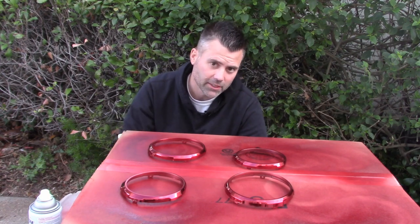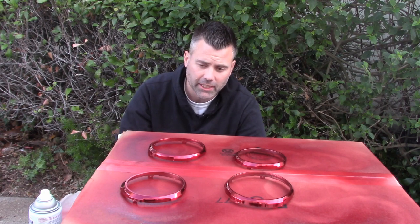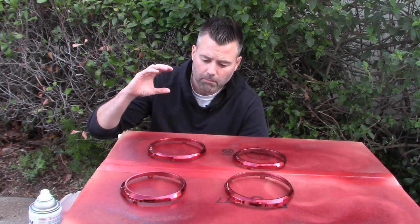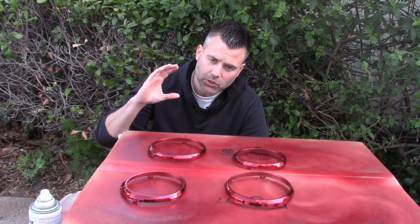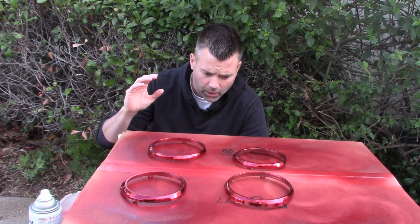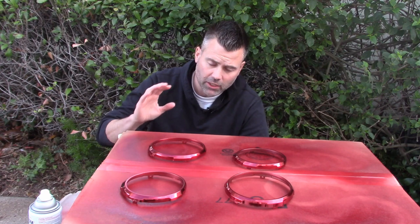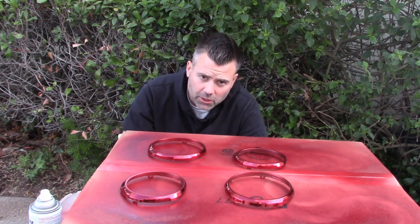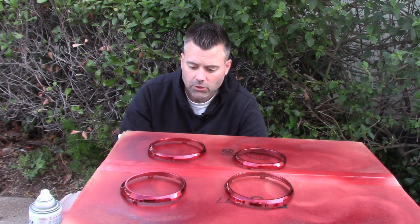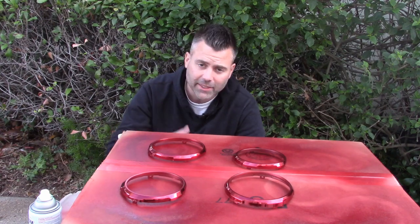For small projects it's really not a huge deal. Spray can clear is always a nightmare — I've done videos on it before. You just have to be very careful. The biggest thing is to try to stay within the same brand, but if you can't that's not a huge deal. Make sure you look at the recoat times on your spray can, and also do a very light first coat — that'll generally keep you from having all sorts of weird problems with clear coat.